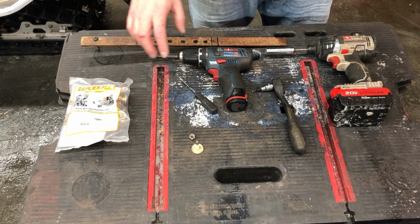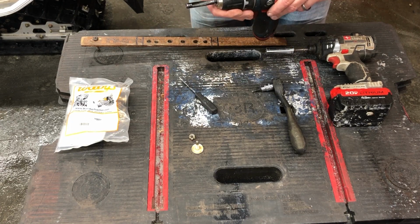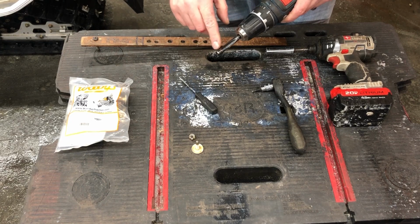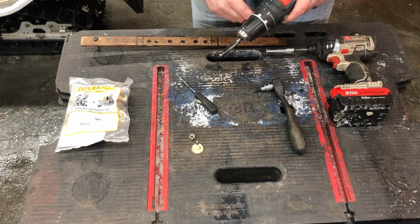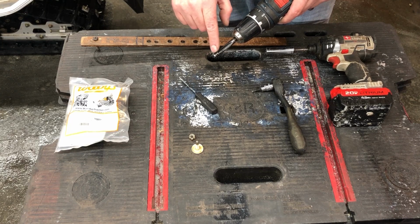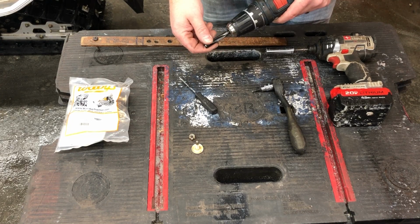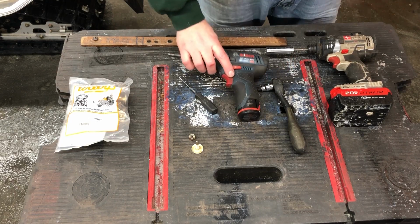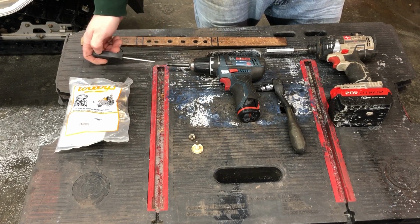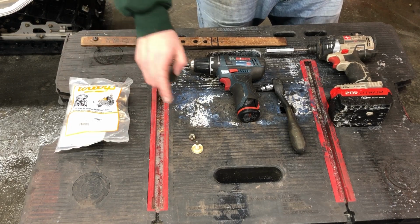As far as the tools that you're going to need, a stud cutting drill. You don't want to use a standard twist bit. You want to use the drill that Woody's designs for it, because it's designed to cut a clean hole in the track, and it will eject the plugs through the cutout on the drill. Another thing you want to have is an awl. So if you do get plugs stuck in the drill, you can just eject them out that way.